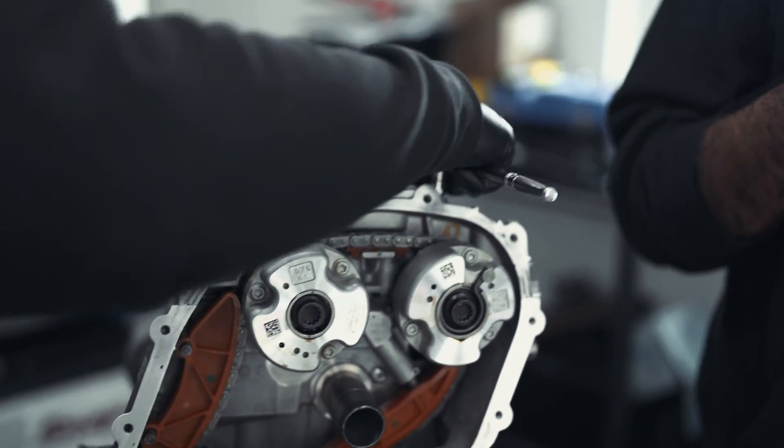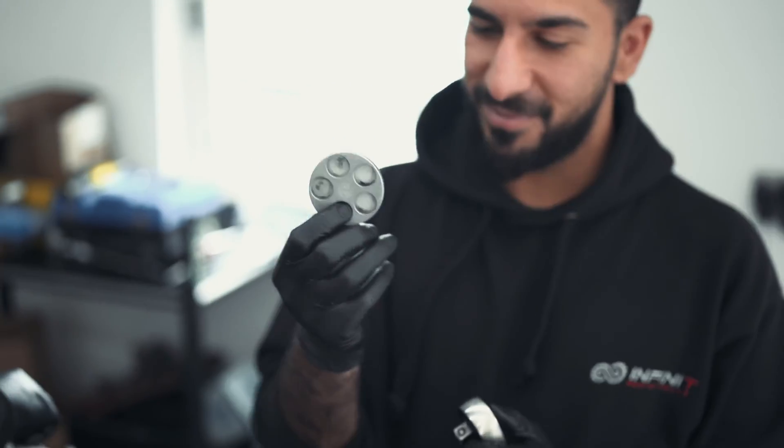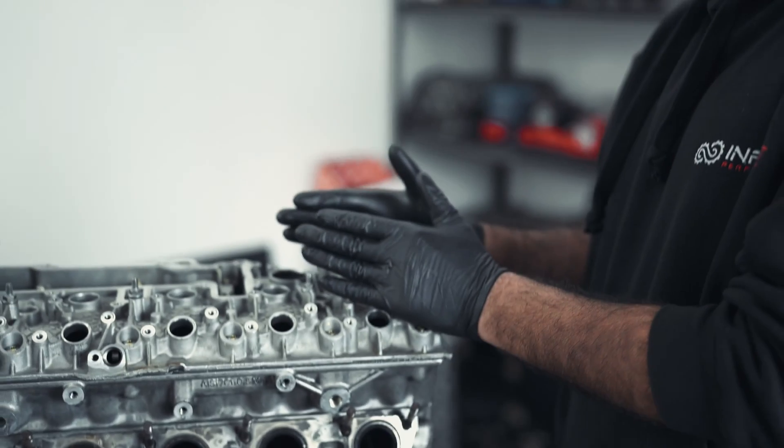If you're a technician who's used this tool before, you're going to know how annoying it is. Steven's removing the timing bridge — we've already removed the crank pin — and I'm going to rotate the crankshaft twice in a clockwise direction and check the timing marks once again. That confirms we've timed everything correctly. After it spins twice, it loses retention in the timing chain, so if there was any incorrect tension in the timing chain, that will all settle as it should be. This allows us to verify the timing and make sure the engine has been timed correctly.